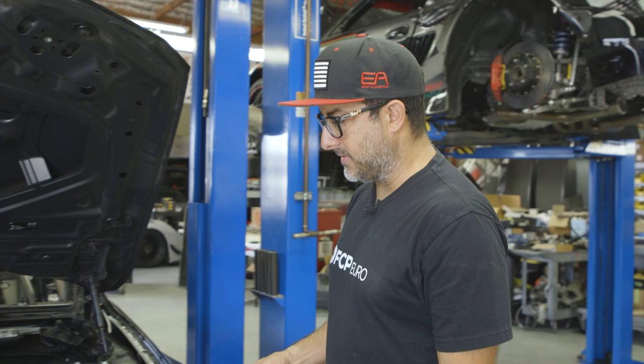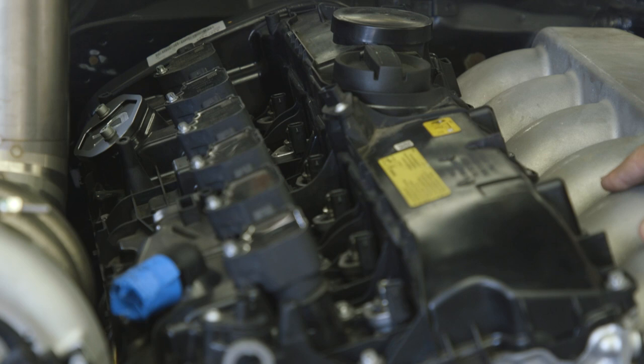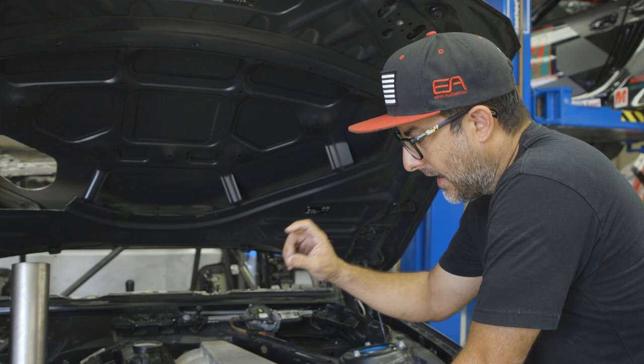Basically, these direct fuel injector ports that are in the head go directly into the cylinder. When you go to port injection, you could leave them bolted down, but they're going to melt. The tips of these get so hot because there's no fuel flowing through them. So we need to pull these out and have aluminum dowels pressed into the head to fill those